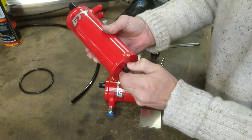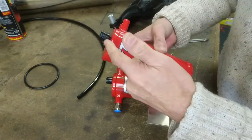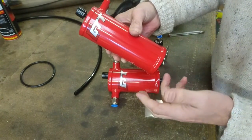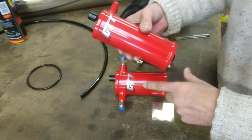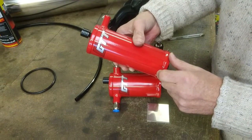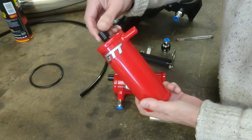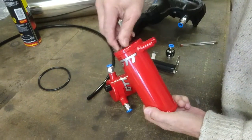Both cans use a screw-in drain plug on the bottom with an o-ring seal for draining. Both cans also use a dipstick system. This is far preferable to a sight glass type with a bit of plastic or rubber tubing, which can cause leaking — certainly on the vacuum circuit. And even if it doesn't leak, after a very short time you can't read them because the plastic will have gone completely brown.